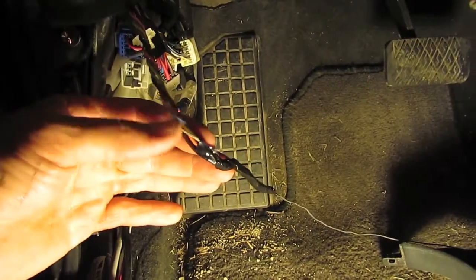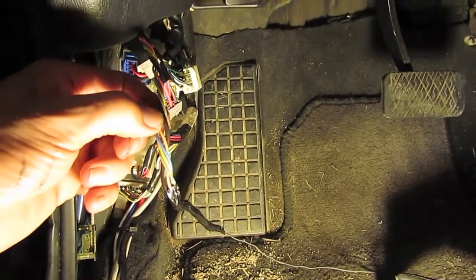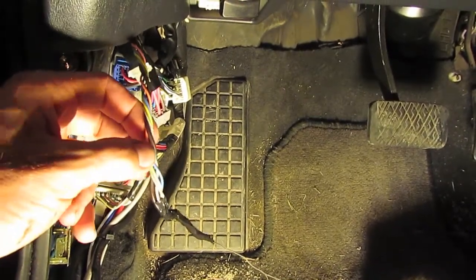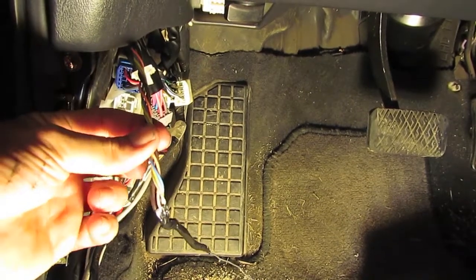Well, the dish soap did its trick. I pulled the wires into the car. In this bundle I have one 16 gauge ground wire and 4 20 gauge wires for accessories I'm hooking up. I don't think I could pull much more, maybe 1 or 2 more wires, and that boot is completely full.